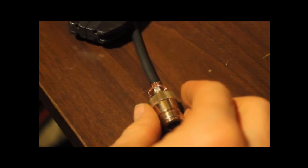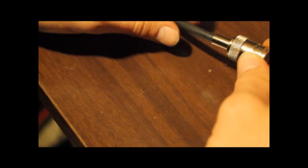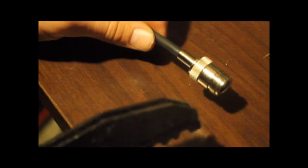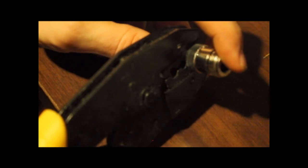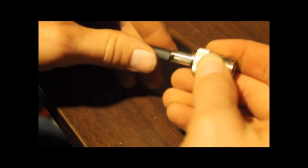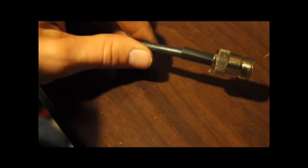Felt it click — all the way down on there. Bring up the crimping collar to slide over the body. Make sure the body stays down on there and the crimping collar is all the way up, then give it a good crimp. There may still be a little flare at the end — that's okay as long as the shrink tubing slips over it. Throw a little heat on the shrink tubing. You don't need to catch it on fire, just wick the lighter over it. A heat gun works great too, but a cheap lighter from the gas station works just fine.